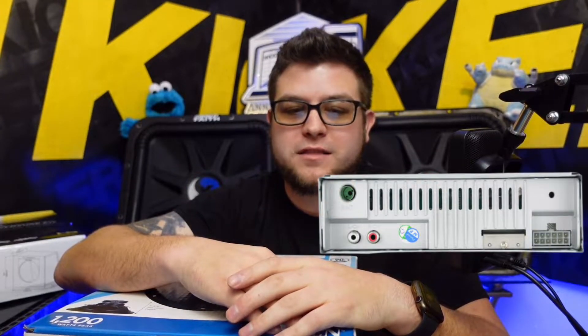Yes, you can use your radio power, but I did that video on this Dual head unit last year and the power wasn't very clean — a lot of distortion past about volume 11. We're trying to get the most out of what we've got. What we're going to have is those four speakers replacing your stock door speakers. Hopefully your car has all 6.5s, otherwise you might need to switch some things around. You're going to have a head unit and an amplifier to power your mids and highs, so the head unit is literally only going to turn on and off and send RCAs out the back. The lefts are going to be bridged and the rights are going to be bridged, wired at two ohms on each channel.